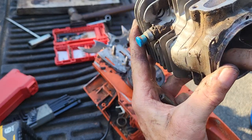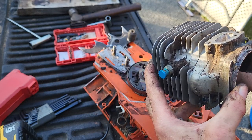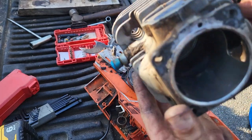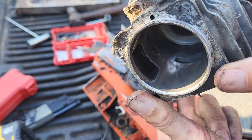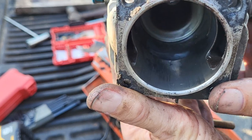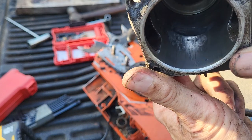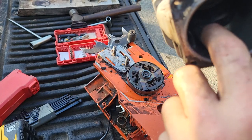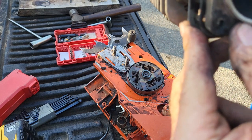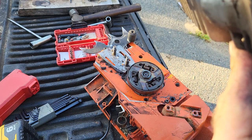It feels to me like it's high transfer, that nothing went through the plating. There's nothing on this side. It's smooth. The whole cylinder is smooth. I'm going to try to hone the cylinder out. I do have a video on doing that back a little ways. So you can see that one score right there. I can see it in the camera, but it doesn't feel low. It's not catching my finger. I think we might get lucky. I think this just might be aluminum transfer onto the plating.